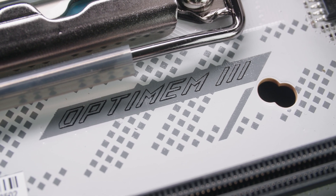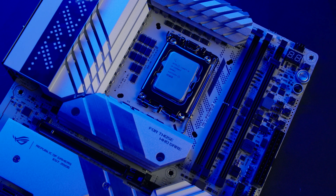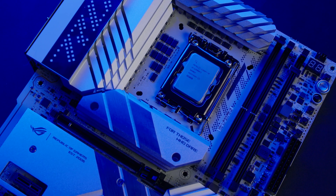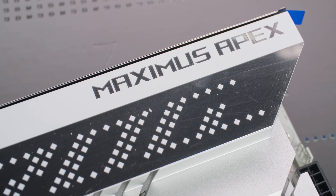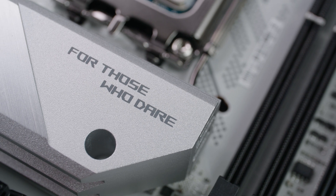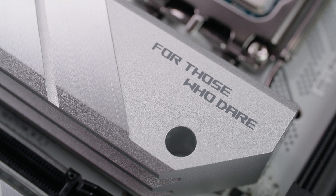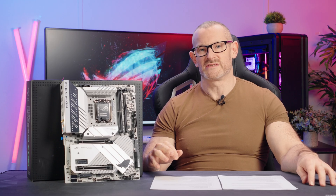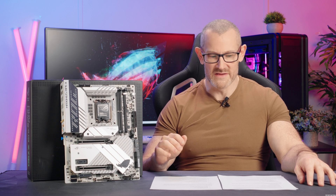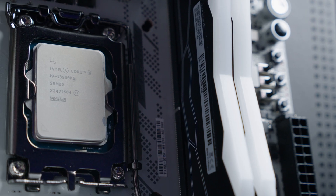Obviously what's very appropriate to this kind of motherboard is a very strong VRM. This has got 24-plus-zero power stages, each rated to handle 105 amps, each accompanied by a high-permeability alloy core choke rated to handle 45 amps. All this with a very accurate power stage and suitably spec'd SMDs means it's supplying a crazy amount of power to the CPU socket, and also to the memory voltage modules — remember with DDR5 the VRMs are in the DIMMs, not on the board. Alongside this power delivery, we've also got very large heatsinks to keep the VRM cool, helping push memory and CPU to higher frequencies while remaining stable.